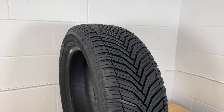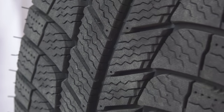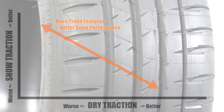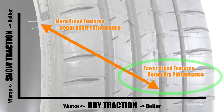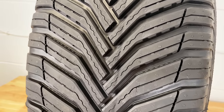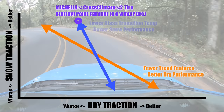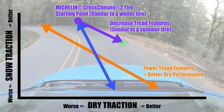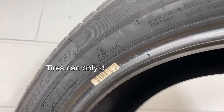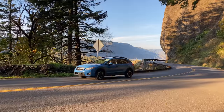So how does it work in the summer? That's where tread patterns come in, and as you can see it has a very distinct tread pattern. The more cuts or sipes and grooves you have, the more biting edges the tire has — which helps in snow. But in dry conditions, you want to maximize rubber on the road and use fewer sipes, because these cause more wear. This tread pattern isn't covered in sipes — it has grooves and patterns, but not the dense sipes you'd see in a winter tire. So big picture: this tire uses a compound similar to a winter compound, but a tread pattern more like a summer tire with very few sipes, putting it in a unique position — able to earn the three-peak mountain snowflake certification, while suffering significantly less wear than a traditional winter tire when driven in summer months.